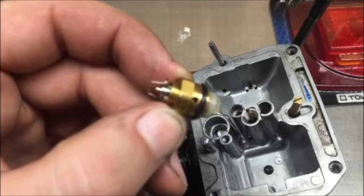Quick note here, because I've got some pretty smart people that watch these videos — see that hole right there? That does allow fuel to go around, where when it's in its position it almost looks like a star pattern, and there's a relief, and fuel will go around there to fill the float bowl faster once that float needle comes off the seat. But make no mistake about it, what I'm talking about is that O-ring seal against the body — if fuel leaks past the O-ring, it's raw, unmetered fuel that we do not wish to have.